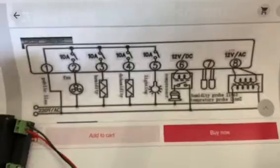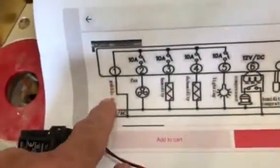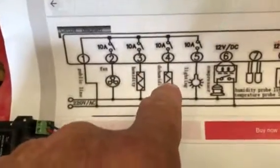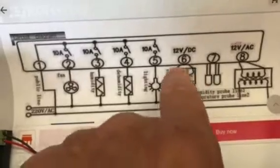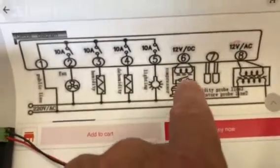They don't even have a website. I emailed them asking for instructions but they don't understand my email. So you've got these eight outlets in the back, marked one through eight. Number one is your public line. You can add a fan on two, a humidifier is number three, a dehumidifier is number four, you can put on a light at five. Then this item here is pretty important — this 12 volt DC is a relay switch which switches on the compressor. So line number six is the compressor, which is your fridge.